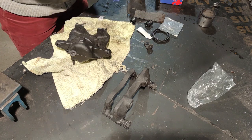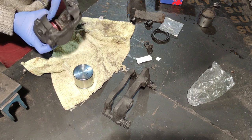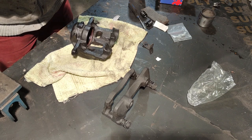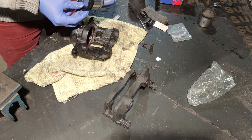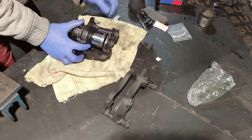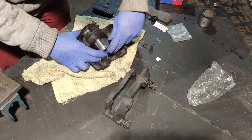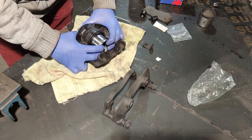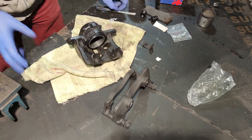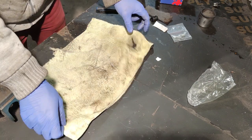Now the piston with some assembly lube. Installing the boot can be a bit tricky. My strategy is to slide it on the piston and get it set in the groove at the same time — like this — and now get the piston straight, slide it inside, and it seats itself on the piston. And that's done. Perfect — set this one aside, flip the rag, get a new rag.